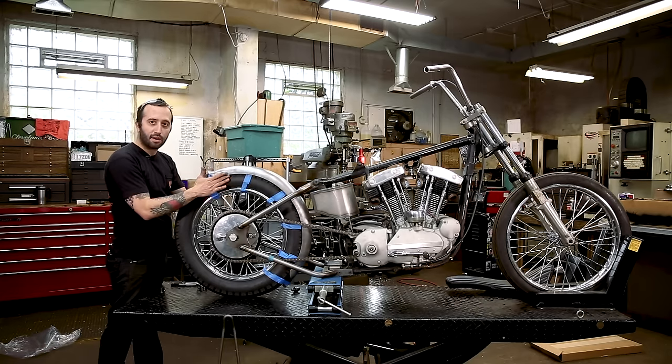So the holes in this plate are 1.5 inches apart. If you ever want to figure out the center to center on some holes, especially if they're the same size, it's really easy. So an easy way to measure how far apart these holes are, so you can mark a center punch on that bottom plate, is you can take your scale and measure from this edge to the corresponding edge on the next hole, because then it's actually a hard measurement. You have a nice crisp line to go off of.